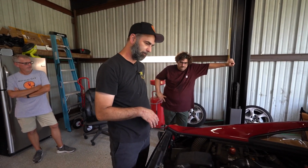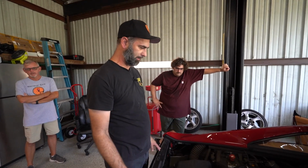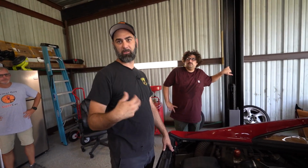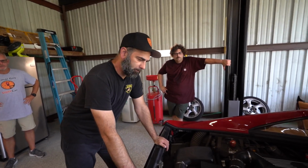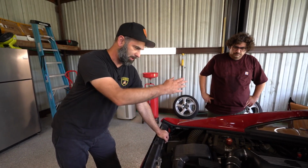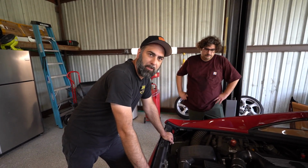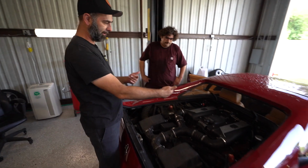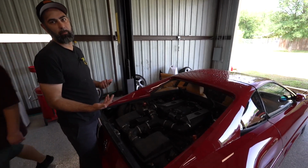Some of those could be a reaction, right? Because if it's running too rich and it's obviously not running right, then a bunch of stuff's going to be reading values out of specification. You can't really say everything we saw as a fault is an actual physical problem, because some of it might be a reaction. Something else is wrong. It caused those things to show up as failures. Like lambda sensor faults, it's not always just a bad lambda sensor. If there's something else bad and it's causing it to run excessively rich and it can't compensate and adjust, the logic in the software might compute that as a lambda sensor problem, because it's trying to process the lambda sensor information and then make a correction, and then the motor's not reacting, so the computer logically thinks, oh, we have a lambda sensor problem. But it's not.